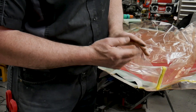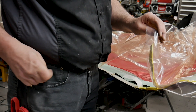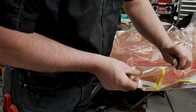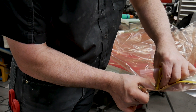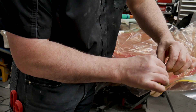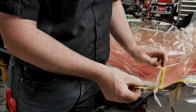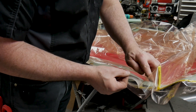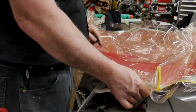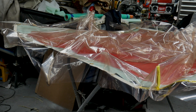I've made my pleat with everything taped up. Then I'm going to unfold that and pull the backing off the tape — I've already pre-formed where the join is, right where the fold is, and it's really helpful. When I was doing this it was winter time and I do live in Canada, so the bagging material was not warm. If it's warm it works so much better — it's so much more flexible. Molds I made in the summertime have bagging material that's just so much more flexible. So in that pleat goes, then I press down really carefully up the sides of the pleat and work my way down the length of the mold to finish the job.